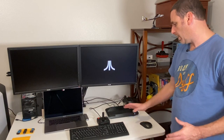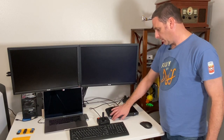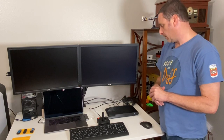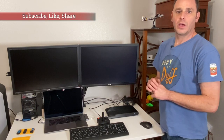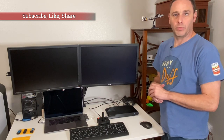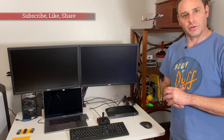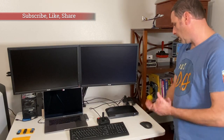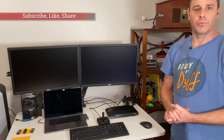What we learned in this episode is how difficult it is to access the inside of the VCS. It's relatively painless to pop off that rear piece, but that doesn't do you a whole lot to get to the actual main board to do any sort of upgrades. You will need to take those four T10 Torx screws that are underneath the feet at the bottom. Upgrading the storage would be relatively straightforward; however, updating the RAM is a little bit more involved. Hopefully these tips will help you if you decide to upgrade your VCS. Don't forget to subscribe, like, and share this video. Thanks a lot — see you next time on RetroAxis.